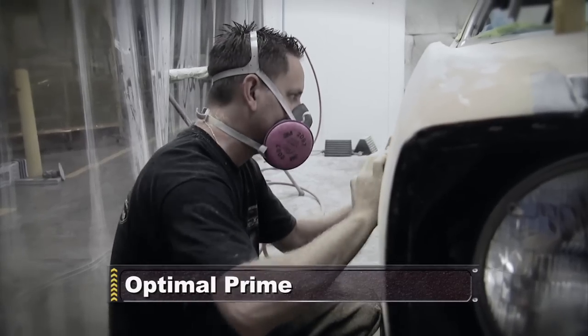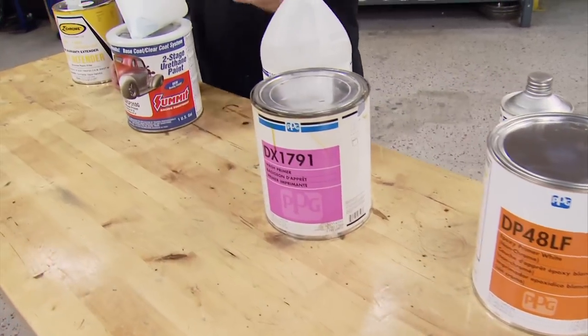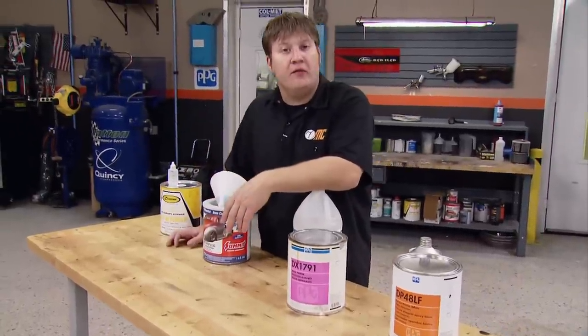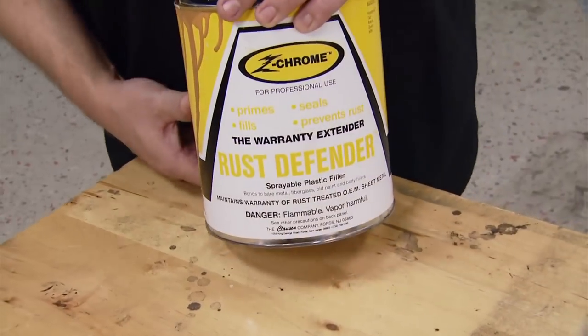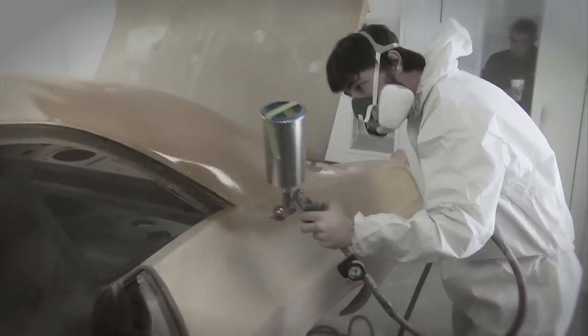Still ahead, we give a Primer 101 course to show you what all the different primers are for. It's been a while since we've been able to throw some paint tech at you, so today we're going to slow down and educate you on why and how to use primer. We get the occasional question about primer and a lot of the stuff you hear out there is misconceptions. Most people think that primer is just some material that they spray on the surface to seal it off for paint — and that is kind of true, but there's a lot more to the story than that. You guys have seen us use polyester filler primer here on the show before, like Rust Defender. For restorations, this stuff works great because it's a heavy-bodied filler primer. When you're trying to block panels nice and flat, it can save you time by allowing you to safely apply a thicker amount of primer at once — it's actually a sprayable form of body filler.